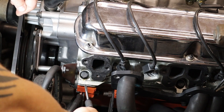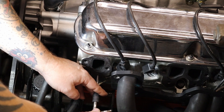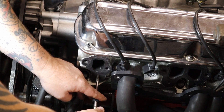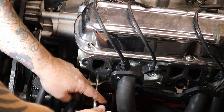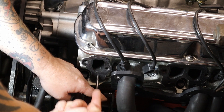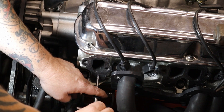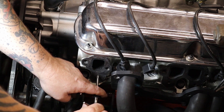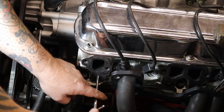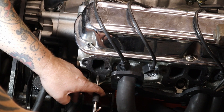For these holes, I did go and take a quarter-20 bolt and check how well it fit — it's a pretty easy fit. To run this tap in, I don't expect any need for cutting oil. I even looked at doing a five-sixteenths, but because the hole goes in on an angle the opening isn't quite big enough. A quarter-20 seems to be the perfect size, and there's really no resistance to this tap at all — it went in really easy.